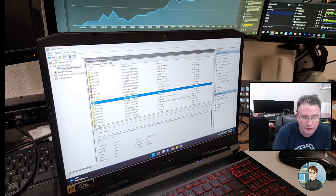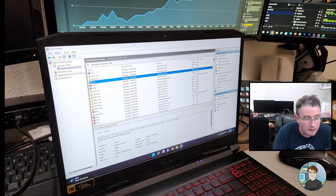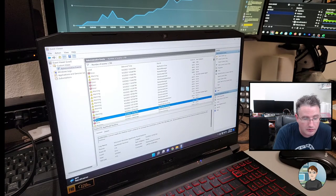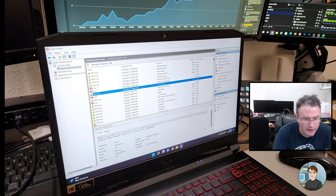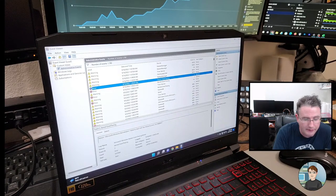That's a message about another computer on the network having the same name. That's okay. It's not okay, but it fixes itself, pretty much. I'm not seeing the usual full-on blue screen type of errors. He hasn't used this computer in a while. These are back from the third. It's the 16th now. There's a time service warning. DNS, it had trouble. Oh, it's because it's not connected to Wi-Fi. Kernel tracking event. I don't think I've seen this one before.